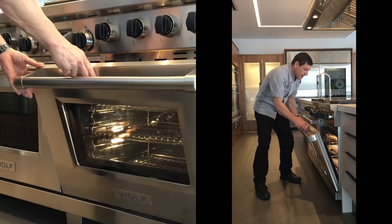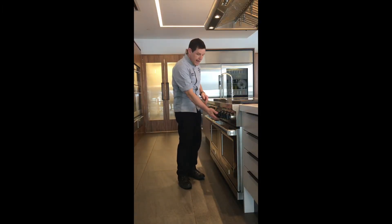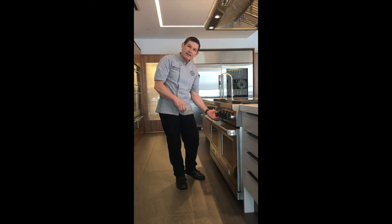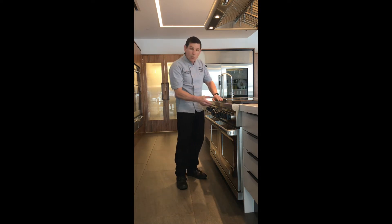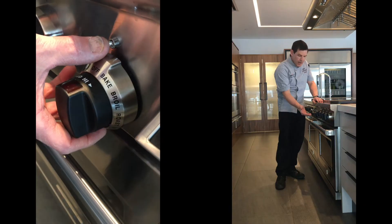When you're operating your oven, you're going to have ten different modes. Those modes are accessed on the bezel that surrounds the black knob in the center of the panel. Each one of the non-highlighted modes is a still oven mode, where there is no convection present. The highlighted section contains all your convection modes, where the fans are in full operation whilst you're cooking. The temperature is raised or lowered by clicking this knob in either direction, high or low.